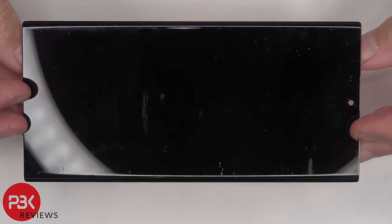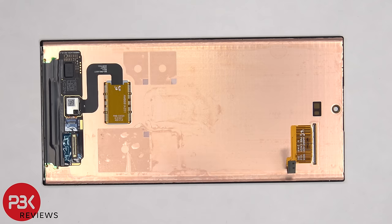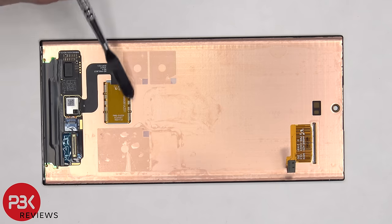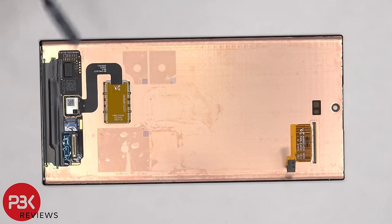Here's a better look at the screen. Prying the screen off was incredibly difficult and took a lot of time and patience. The adhesive around the screen holding it down is really strong, so prying a working screen off will require a lot of time. There's a flex cable for the S Pen support, the cutout for the proximity sensor and front-facing camera, and the in-display fingerprint reader. This fingerprint reader is soldered to the main screen, even though it has a cable connector on the bottom, so replacement screens would come with this fingerprint reader pre-installed.